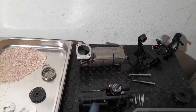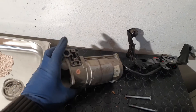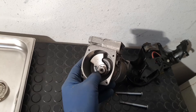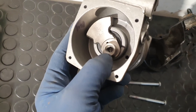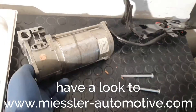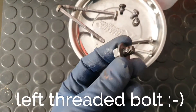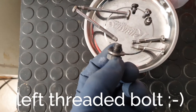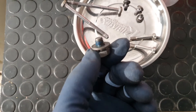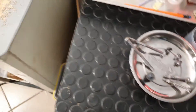This is the main unit — the electric motor — and usually nothing is going to happen here. What I read on forums is that it's very reliable and long-lasting. Keep in mind a very important detail: this is a left-handed thread. We have the bolt here, so keep in mind — very important — you apply some thread sealant and you undo it by turning clockwise.